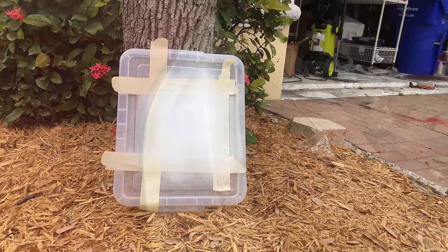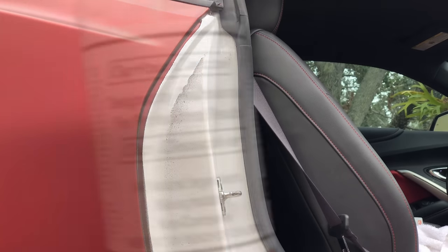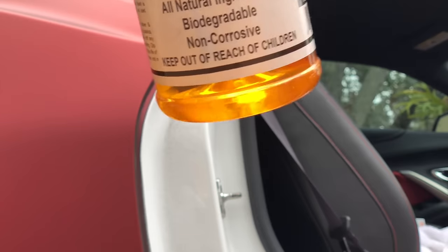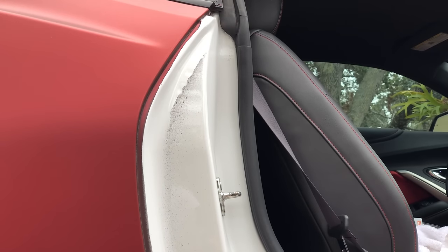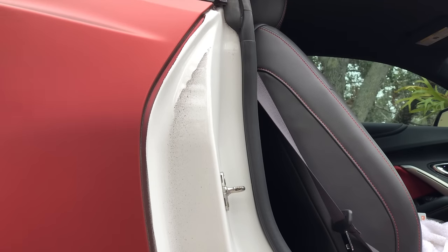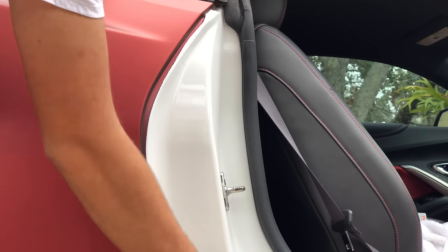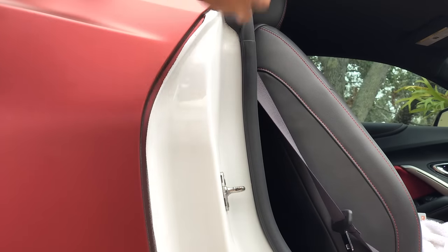To maintain PlastiDip's peelable ability you need to do around five to six coats. What most people don't like about PlastiDip is overspray on your car. As you can see, I have some overspray inside my door jams. DipYourCar makes a fantastic product called Dip Dissolver — it's a lot like Goo Gone or Citrusolve, but specifically made to remove PlastiDip. All you have to do is spray some onto a microfiber towel and wipe where you don't want it — it comes off super easy. Just like that, it's completely clean.